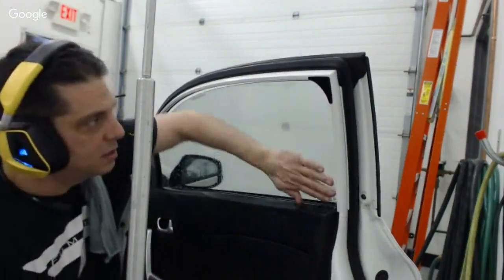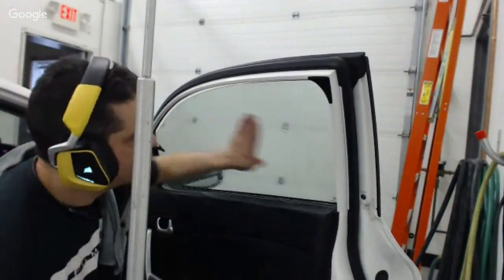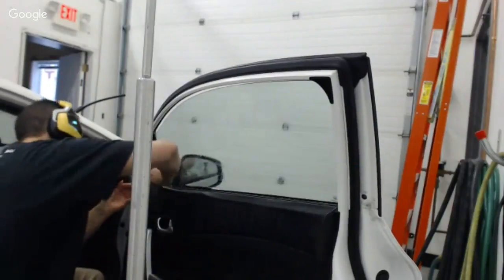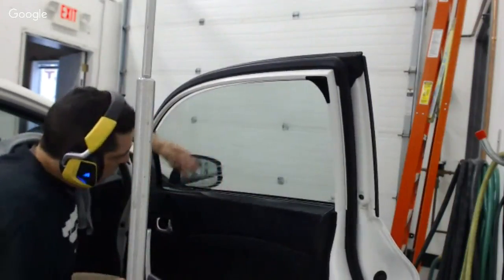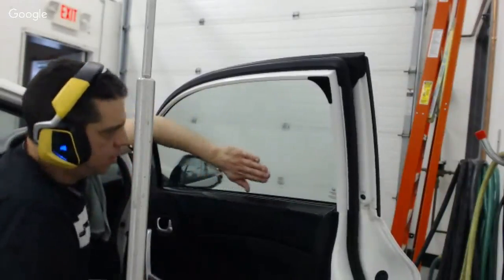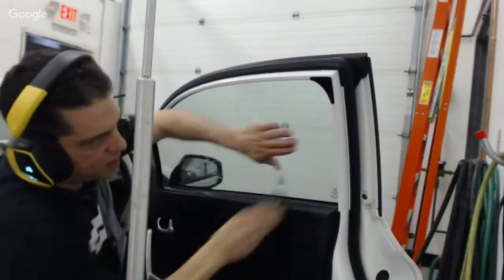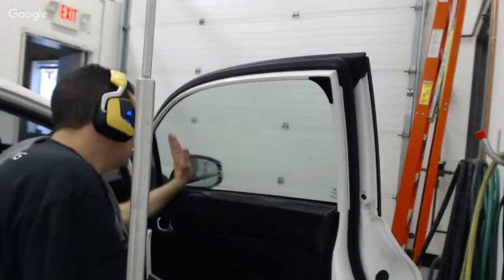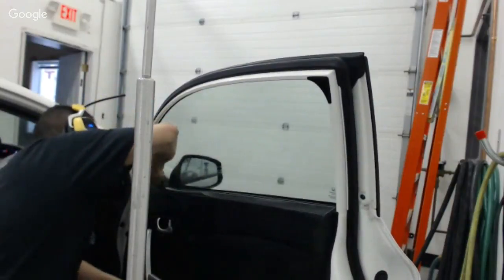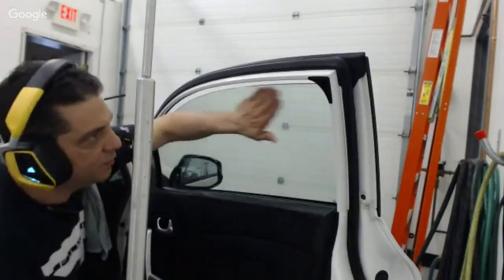Now you can see what I'm doing. This has become one of the most important things that I do: feeling this glass with my hand and feeling for little chunks of stuff. And I feel up here, I've got a little bit. There's not a method that I feel more confident about. If you're stripping windows and you're not utilizing the sensitive portion of your hand like this to feel for contamination, just try it. Do it in all your cleaning practice. Anytime you scrub the glass, feel the glass with your hands and feel and look around for bumps. Basically, you're looking for contamination.